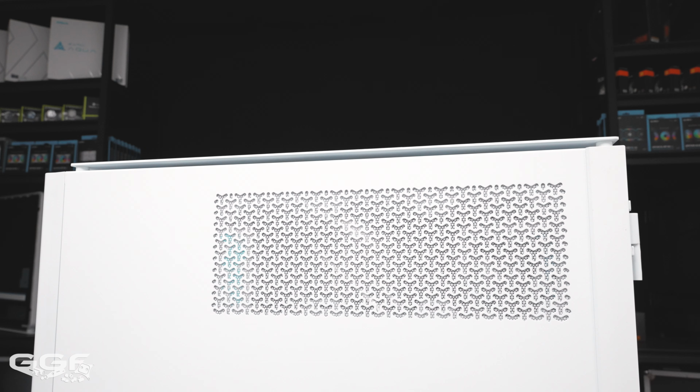But yeah, dual 4090s in this build because, what the heck, let's fill it out. And then below that, I've also added a quad M.2 card as well because this is Threadripper. I can do four SSDs on the motherboard. It does 3 Gen 5, 1 Gen 4, and that bottom slot was locked at Gen 4, but it was a full 16. So I can bifurcate that bottom card and I can do by 4 by 4 by 4 by 4 for those four Corsair Gen 4 SSDs. So that will make a monster system.